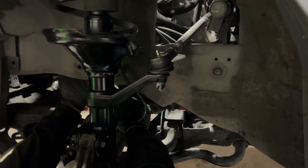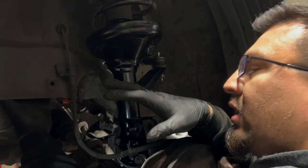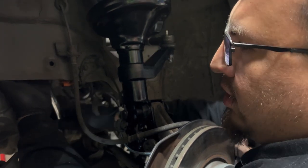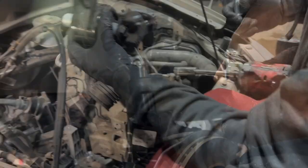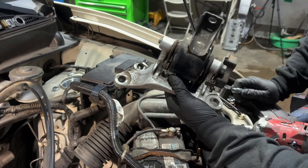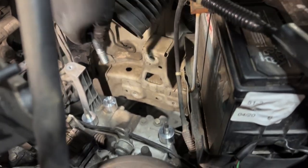These three bolts — to remove these three bolts for the transmission mount, the one that goes straight to the chassis would be getting the lower two from here. It is kind of a hidden view; you won't be able to see it, but as soon as you get the ratchet into the bolt you have all the room down there to do it. It's a lot easier than doing it up there. Joseph just removed the transmission mount — keep in mind this is a manual transmission; the automatic might look slightly different. We added the three spacers.